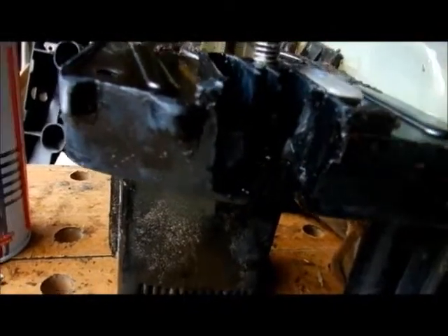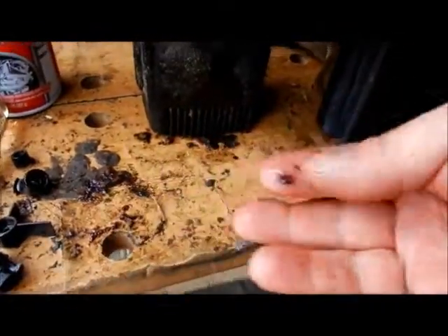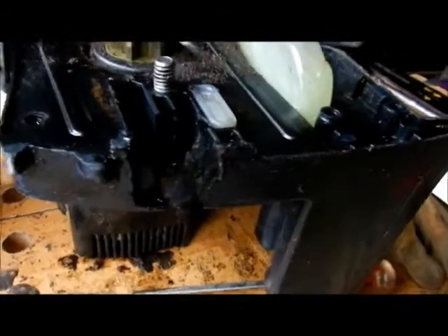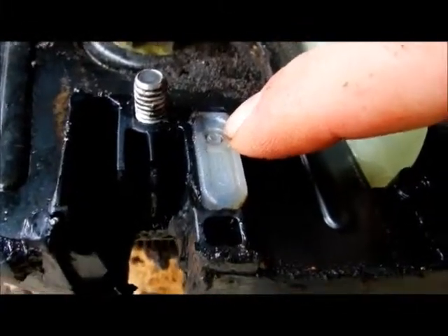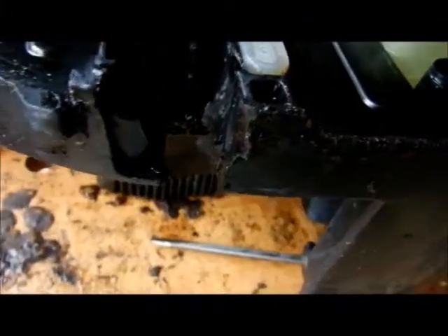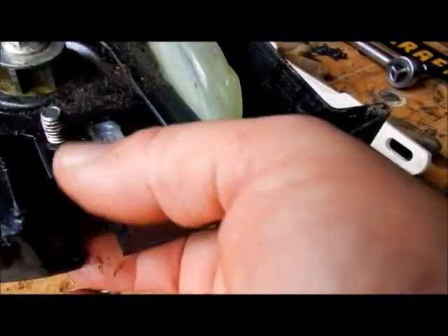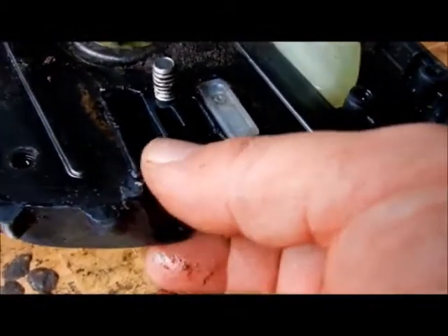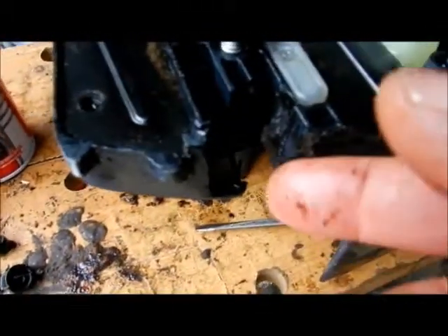I might just hit it again. You might want to do something I didn't do and put some gloves on, because it is cold when you're working with your hands. Do a wipe-over — if it doesn't look clean enough, do it again. You want it dry before you put anything on to start molding things into place. Remember keep this port free and clear — that's for your chain oil coming in. First step: build up this area leaving room for the screw that goes in there. Second step: the screw. These pieces should be easy to glue back on.